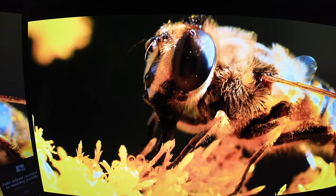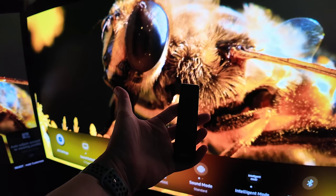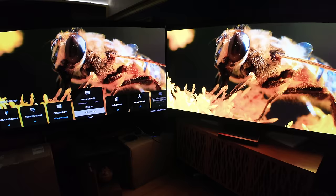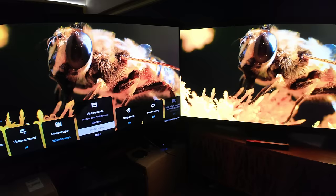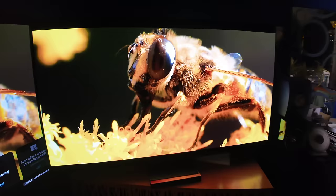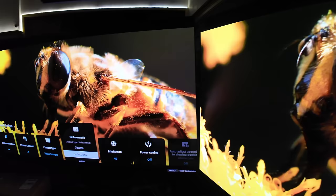I'm showing you step-by-step how we change them. By matching them, I mean whatever tone mapping calls for in that specific preset. On Sony, it would be brightness preferred or gradation preferred. On Samsung, it would be static or active — those will be matched. In Filmmaker mode you will see static as the tone mapping for Samsung, and in Professional it will be gradation preferred. We will match the color temperatures as well. Dynamic for Samsung only has cool and standard, so we will match them that way.